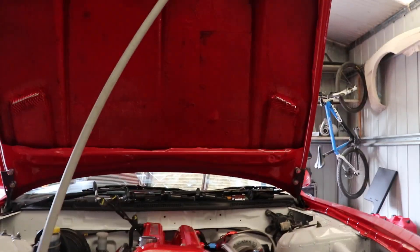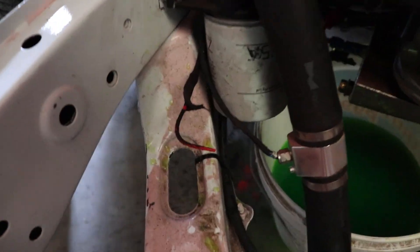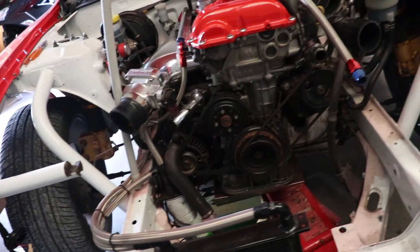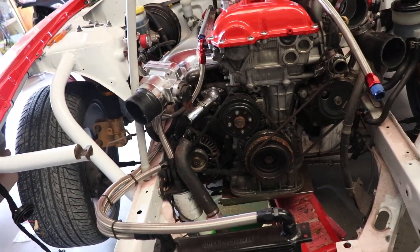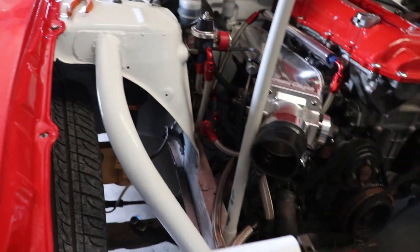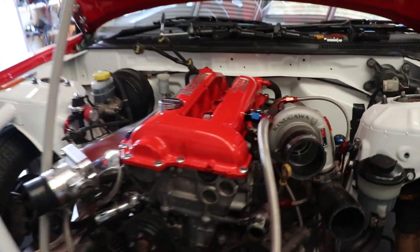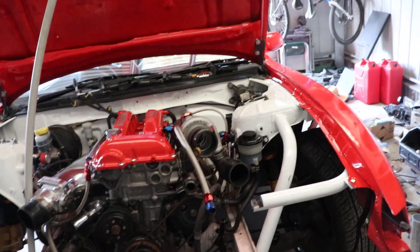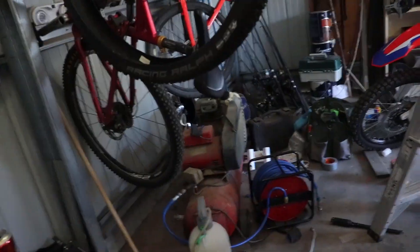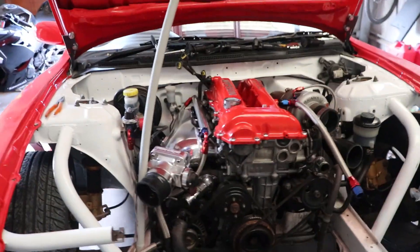We're making some progress — the front is sort of out, there's a bit more bare in there. Got to disconnect the water-temp sensor to get rid of that hose, got to remove that oil cooler, unless I want to try to pull the engine over it — it'll be easier without it. One of those lines goes to the motor. Probably going to start unplugging some of the wiring, maybe drop the oil and the power steering fluid. There won't be too much to disconnect really. I'm leaving the gearbox on and just pulling it straight out.